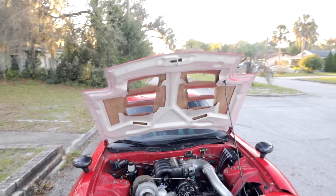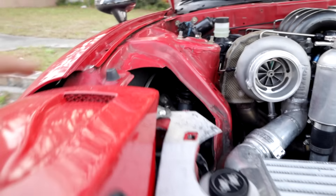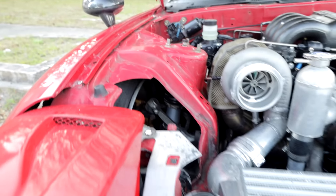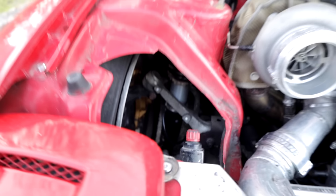The plan is to just drive it next week, go test it at OSW, and get ready for a big event coming up. I'm not going to tell you guys what the event is yet — you'll have to wait and find out. I want to get the car 110% before the event and get my driving back up. This thing is already way faster than the FC was. One thing I do want to change — I need to hit up my boy Camper, because these knuckles have a crazy angle on the upper control arms due to the ride height. I want him to make a tubular upper that's offset a bit higher so it sits more parallel. That angle is going to cause binding and I don't want that at the big track event.